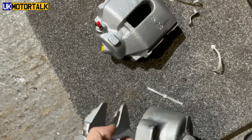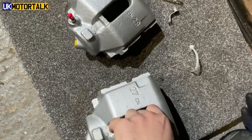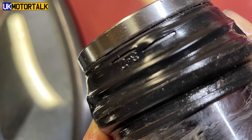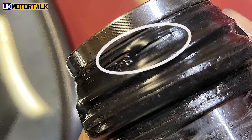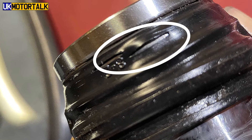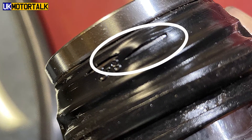I've done the brake calipers — well, I had a bit of a nightmare. I put one of the front brake calipers together and it went together fine, but on the other one the rubber boot stretched and split — not what you'd expect. Quite often people poke these things down with a screwdriver, but it actually split at the opposite end, which is really unusual, and then continued to split in other places. I'm guessing it was faulty. I emailed Big Red saying 'for the love of God, please help me,' and they came back saying no problem, they'd put one straight in the post first class.